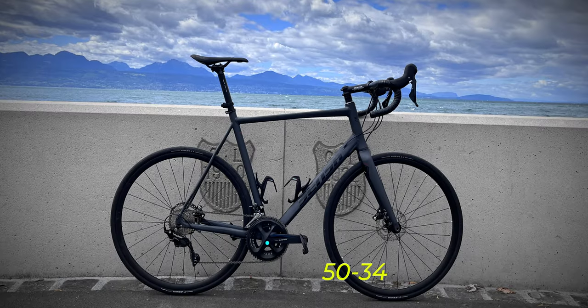How many gears do you normally use during your ride? In my case, the current setup for my road bicycle is 50-34 in the front and 11-32 on the back. I would say that it is a common setup that we can find in most road bicycles. I bought my bicycle like this with this configuration — no one asked me if it was good for my needs. Bicycle manufacturers use the same components in large quantities to keep production costs down, but that doesn't mean the setup we have is the one that we need.